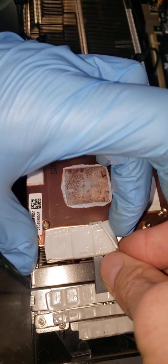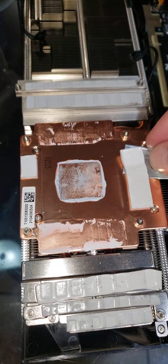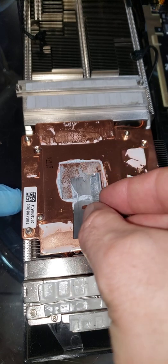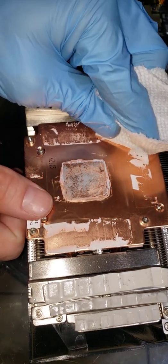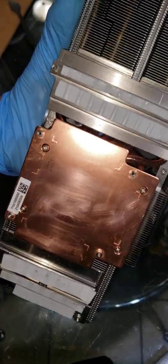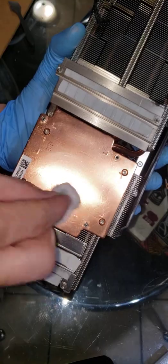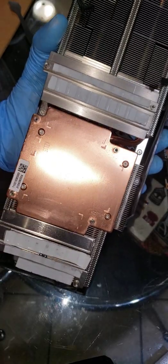This one's extra tough right here, fairly crunchy. Now gently just get the thick part of the paste off — we're not grinding into this copper. Just wipe this off nice and clean. See how that copper is still nice and clean? I didn't go all crazy and scratch it up. That's how you want to do it — nice and clean just like that.